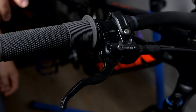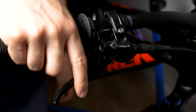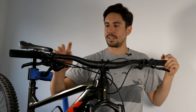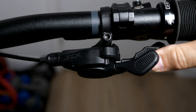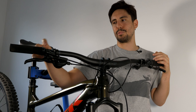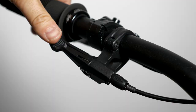It's running Shimano hydraulic disc brakes with standard levers — the same ones I had on my Vitus. I prefer one-finger braking so that might be something I'll upgrade later, probably to Shimano Deore one-finger levers. It does come with an SLX shifter — my Vitus had a Deore. The SLX is not integrated onto the brake levers like on my Vitus, but it's a 12-speed shifter and it feels really comfortable. Moving it under the brake lever would bring it closer to my hands.